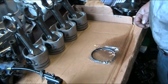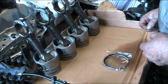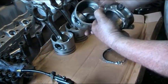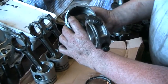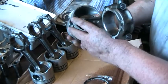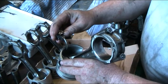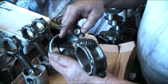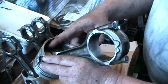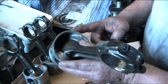At this stage in the engine build, we can see that we have connected all of the pistons with the pins and conrods in the correct manner. In the bottom of some late engines they have an oil cooling system that actually runs oil through the workings of the piston and back out the other side. This is done by what is called a spray bar or spray jet. These sit in the block and inject oil into a small cavity that loops through the piston and back out, which slightly lubricates but also cools the piston — very important in this high performance diesel engine that we're building.